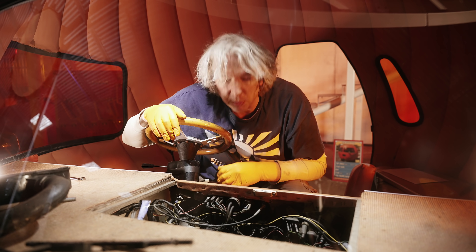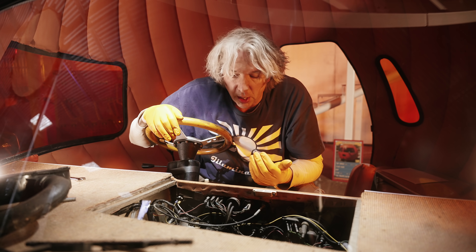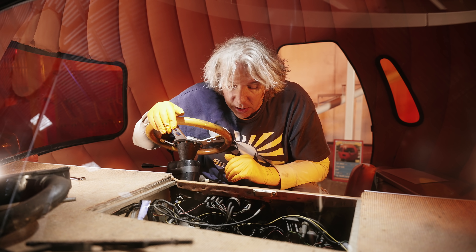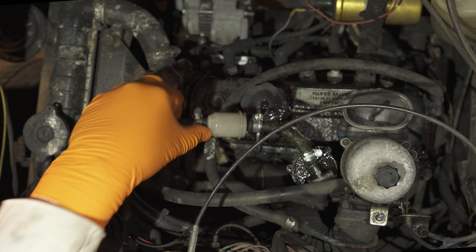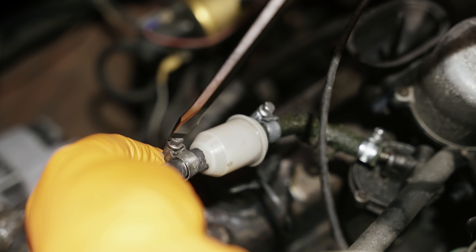It's just pouring fuel all over the engine, which would explain that smell. Over time it must have started going a couple of years back, and as I haven't attended to it, it's clearly just got much worse. So obviously that is going to be the next thing to fix, and I think while I'm at it I might also replace the fuel filter for a new one — it wouldn't hurt.